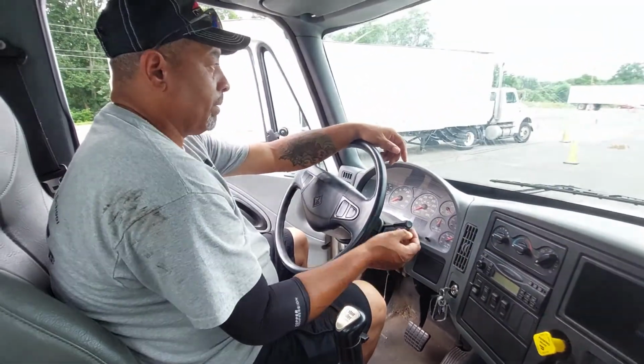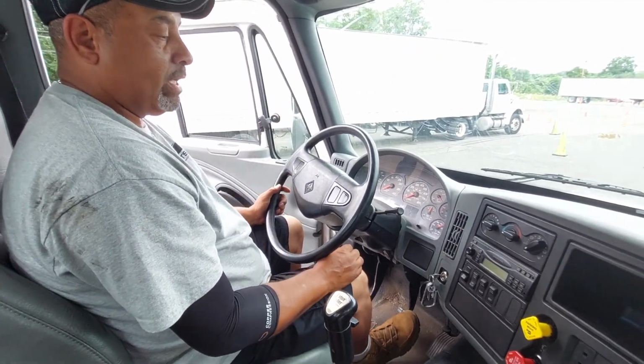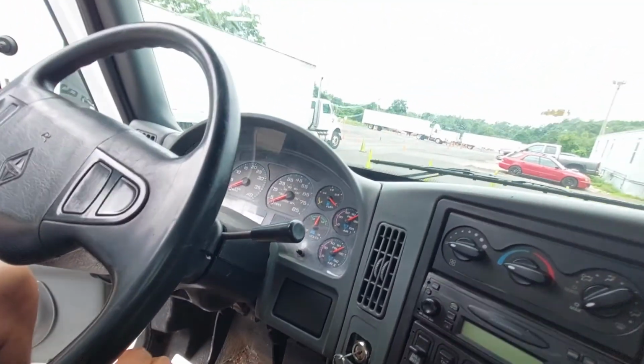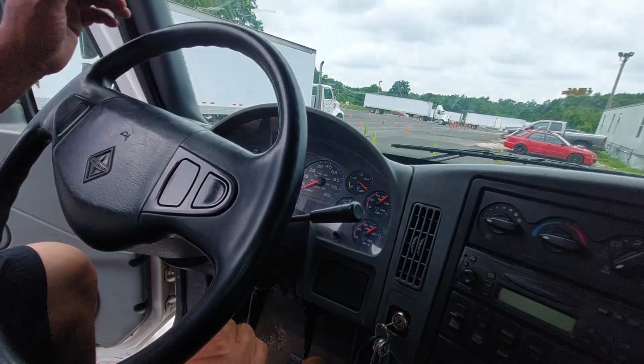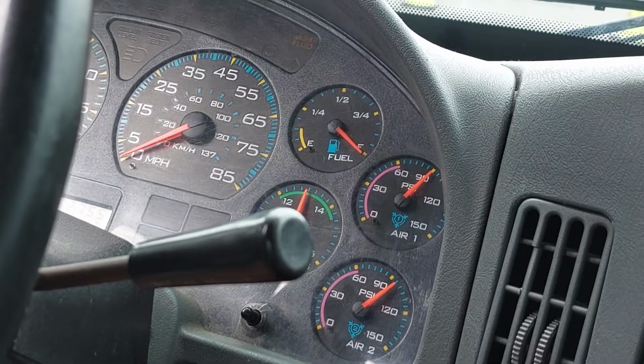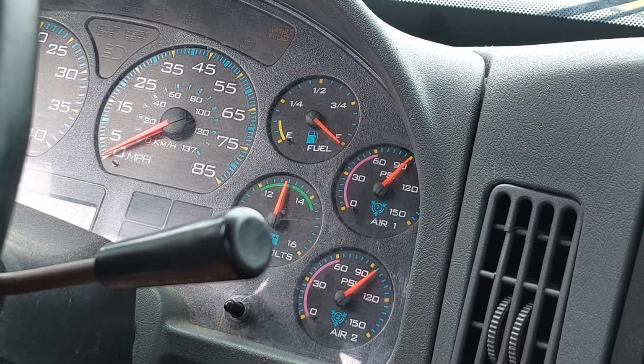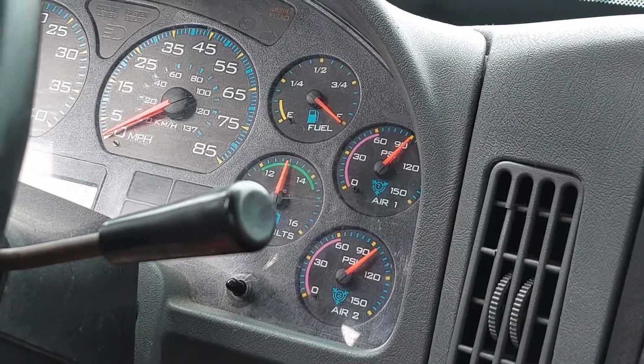All right, so next thing I'm gonna do my 4 psi leak check. And what I'm gonna do is I'm gonna hold down on my service brake. And that's for my initial drop of 5 to 15. I'm at 90 pounds, so I lost 10 pounds right there. Now I'm going to wait my minute, make sure I don't lose no more than 4 pounds in 1 minute.